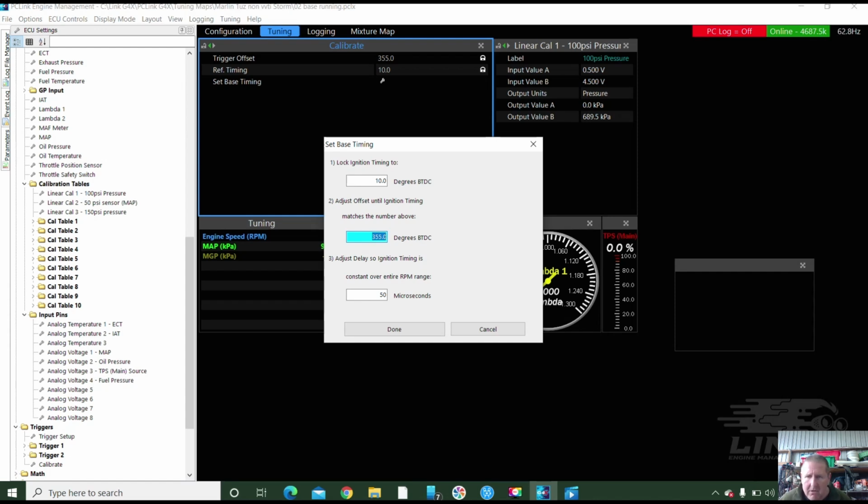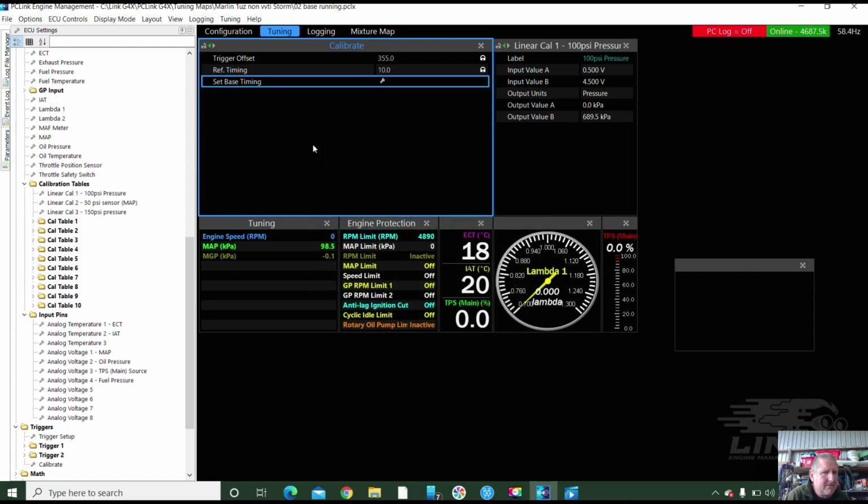I'm sure I've got that same map on this other laptop. Toby's ute was individual coils, and I calibrated that one myself. Oh, that one isn't right because his one hadn't been adjusted and the timing was way out, but it still someone managed to run last time. So my trigger, yeah, I know. 355 is correct. Done. So that should put our timing in the correct place.